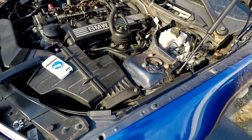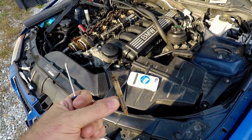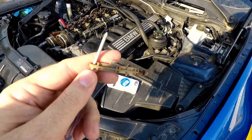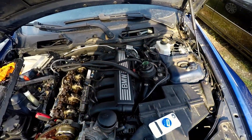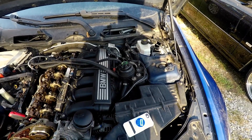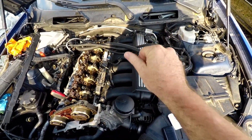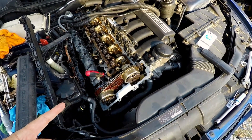I reached back down in there with a little screwdriver, felt around, and located the hole which is right below the starter. You can almost see it from the top but you can't quite, and you cannot see it at all through the bottom. The hole is there — I stuck the screwdriver in the little hole and pulled it out. I was a little worried I wouldn't be able to find the hole again but I did. Standing on the driver's side with my left hand, it slipped into the hole pretty easily. I pushed it in until it hit the flywheel, then rocked the crankshaft back and forth with the ratchet on the front — didn't have to take the fan shroud or anything out — and pushed the crank pin in with my right hand. I have a screwdriver in number one cylinder; cylinder number one will be all the way up when this is lined up.